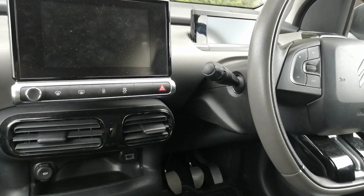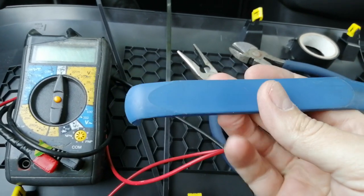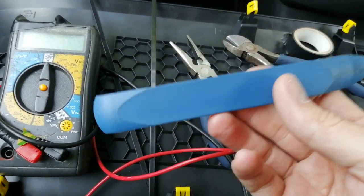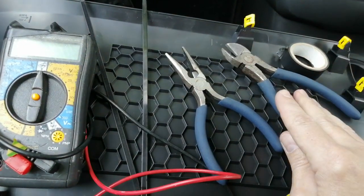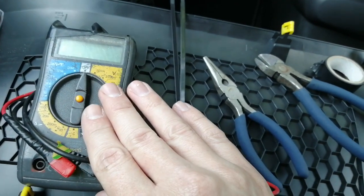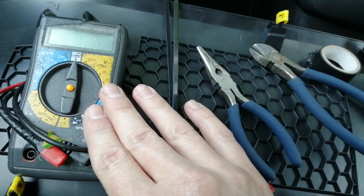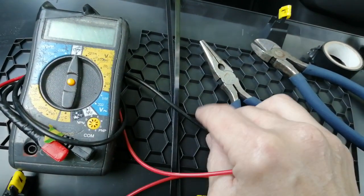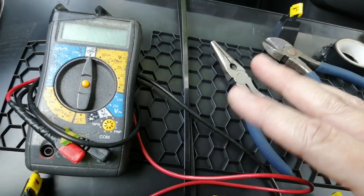Let's have a quick look at the tools we're going to need. Most important is a plastic leverage tool — available from eBay or Amazon for about a pound or two. You don't want to be levering plastic car trim with a flat blade screwdriver; you'll put big dents in it. You'll also need some snips, long nose pliers, a bit of electrical tape, a couple of cable ties, and a multimeter or a test probe screwdriver. I'll be using this to touch the top of the fuses to check for a live signal, in combination with your owner's manual to find an ignition-switched live fuse — something like the heater blower motor. We won't be using anything critical like ABS or airbags, just an auxiliary circuit.